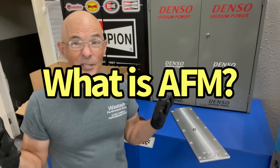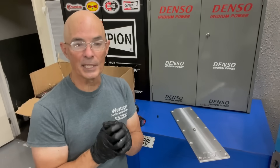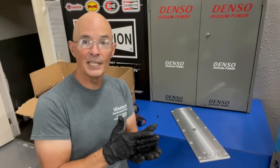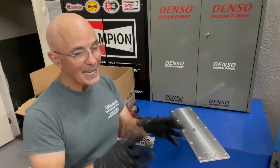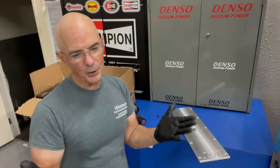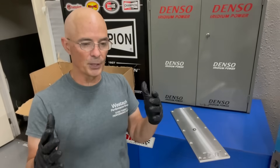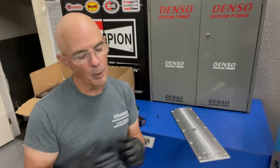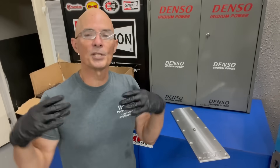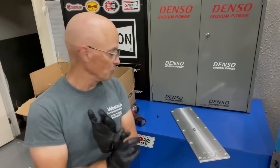What is a DOD? What is an AFM Delete? Well, the way it works on the factory GM LS motors — DOD and AFM — is they allow oil pressure to bleed away from the lifter, making the lifter inactive. They also turn off fuel, basically trying to get the V8 to run as a four-cylinder to get better mileage. During the normal drive cycle where they measure this, it probably does help, but a lot of guys still complain about the fuel mileage. The problem is when we're installing a performance camshaft, we definitely want to get rid of that.